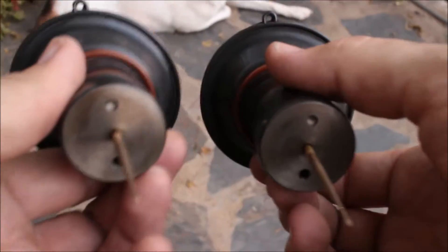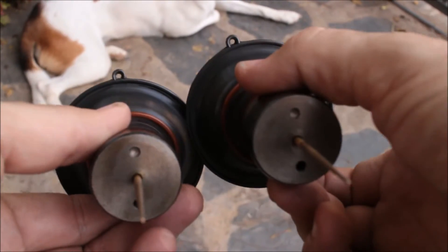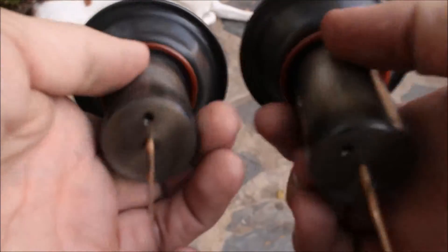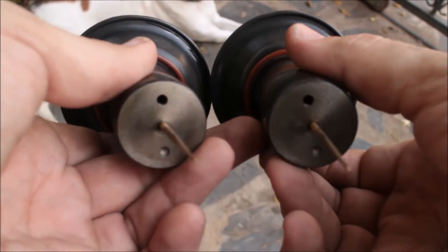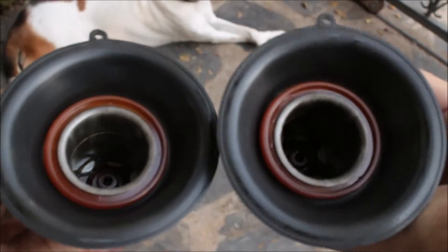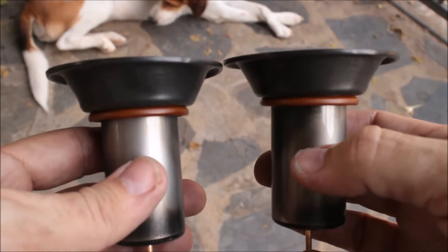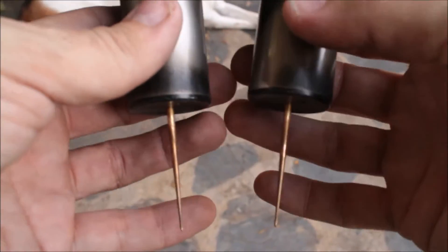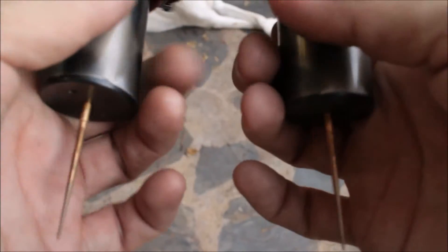Here are the two side by side — you can see the tab up there and they are lined up identically to each other. In the carb, the hole at the top is lined up with the incoming airstream as it's supposed to be, so the alignment of the diaphragm and the carbs is okay. They look identical as far as the needles but I'm going to measure them.